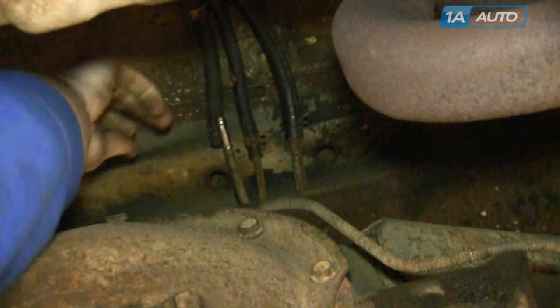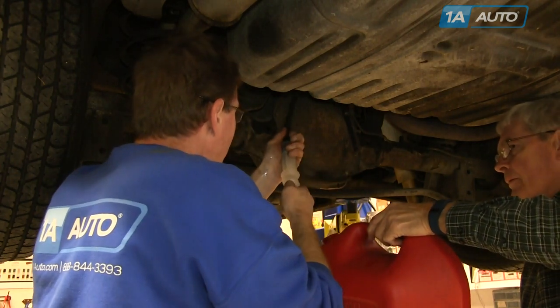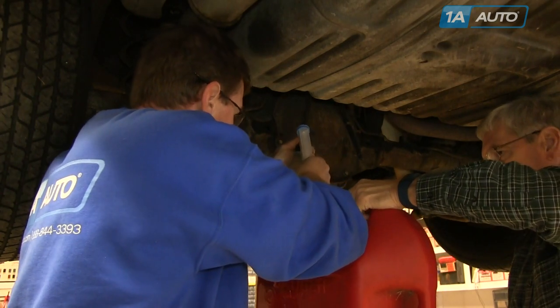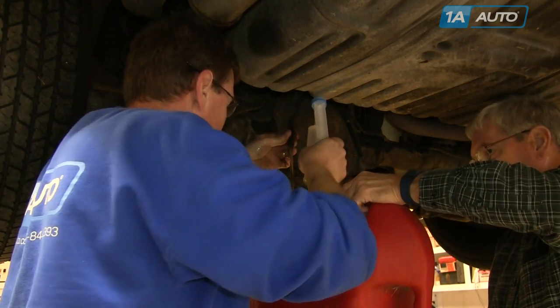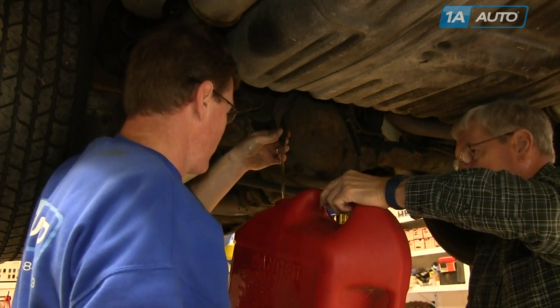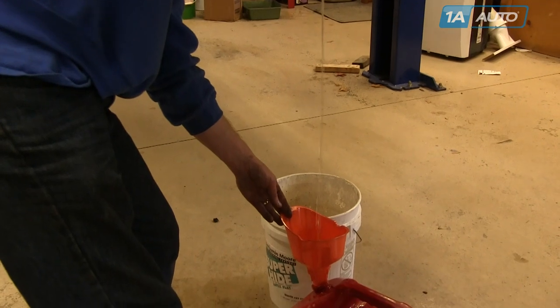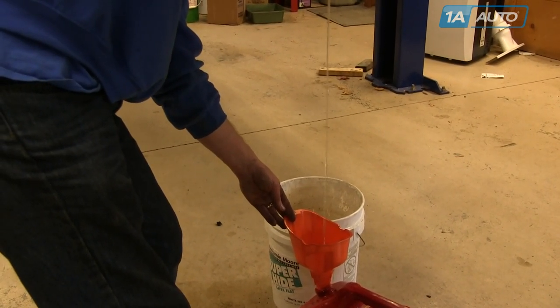You want to generally start with as little fuel in the tank as you can. But if there is fuel in the tank, take the largest line — which is your main line — then use something to create a vacuum and get the fuel flowing. If you hold that line below the tank, the fuel will just drain right into whatever vessel you want. You can see here I just drained it into a five-gallon tank, and you can pretty much go until it stops.